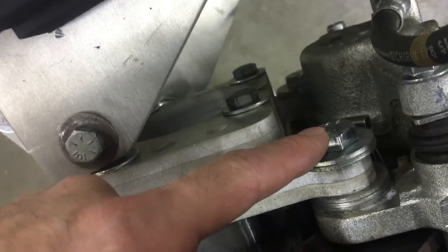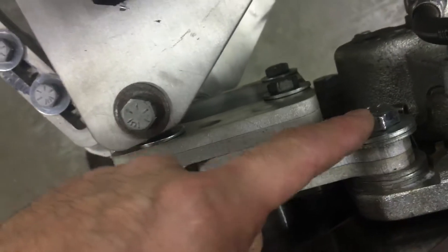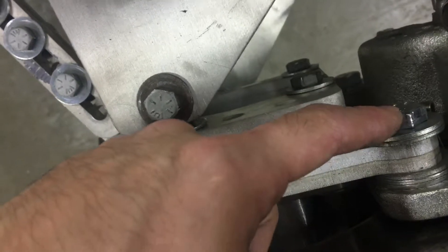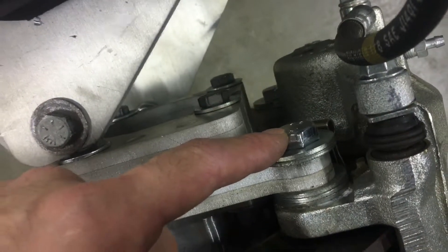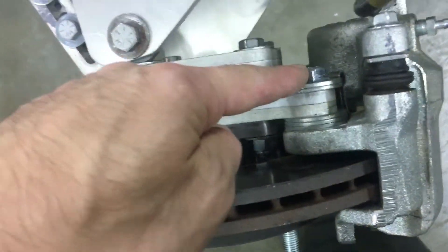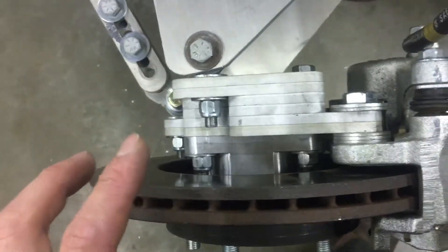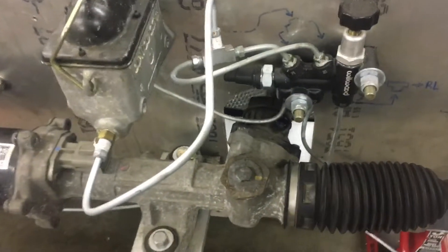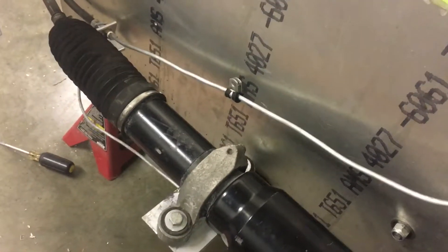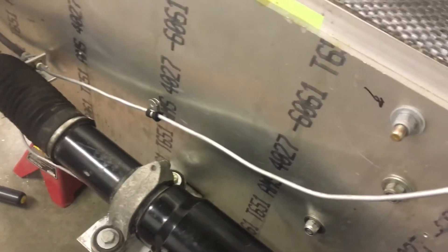Those are just about the washers we used. We went with a shorter M12x1.25 — this one's probably a 1.0 threading. On the passenger side it was actually a slightly bit longer, a 1.25. So we went with four there and still two on that side, just so we can still have it somewhat freely spin. This is a different rotor, so we'll see some significant changes on how that works. I also marked it on the passenger side as well — it's right here in the middle, so that clears it a little bit more.